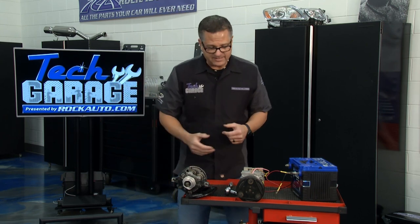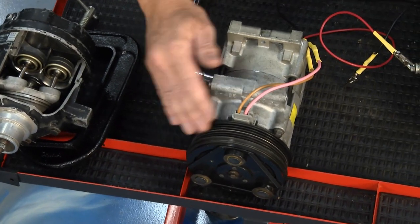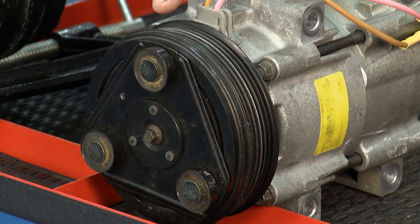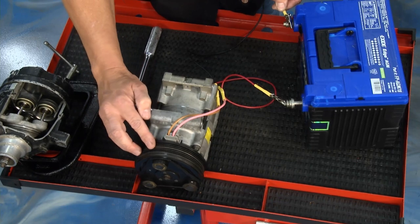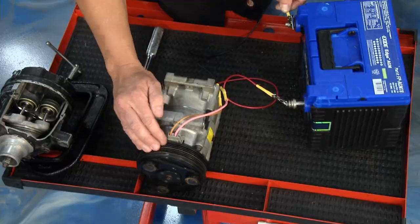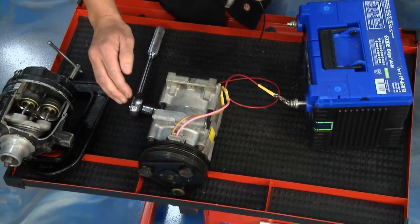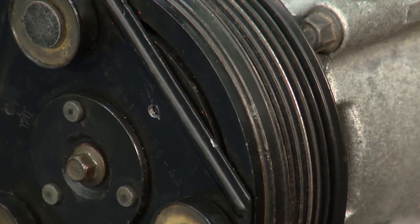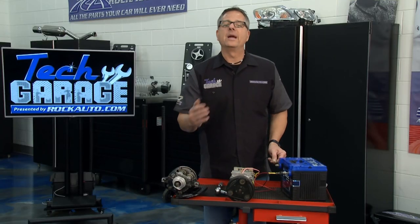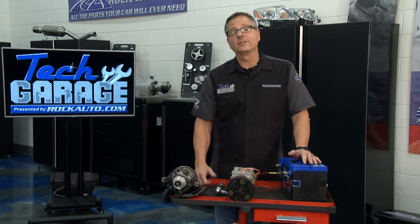Everything's fine when I push the pulley — you can see it running. But once I magnetically engage that clutch, you see the clutch pull in and out, and that starts running all the pistons inside. Once we develop that load, it makes that pulley growl and we start to get that noise. Once disengaged it spins really easy, then connect it — everything's pushing inside the compressor, the compressor starts working, and we're having a bearing failure. Brian's about got the compressor off — let's check in with him.